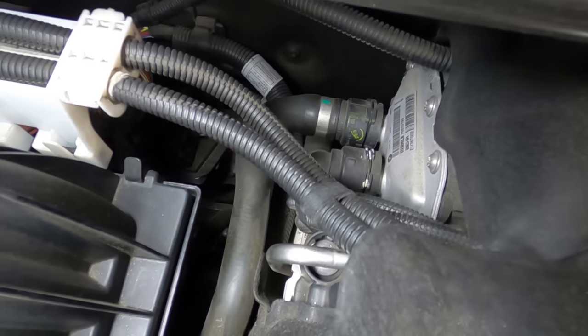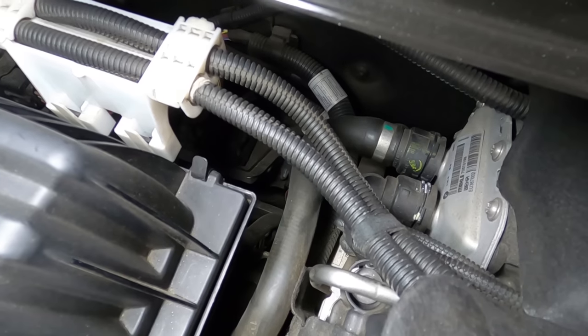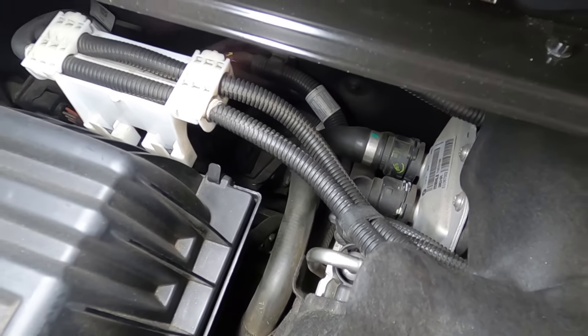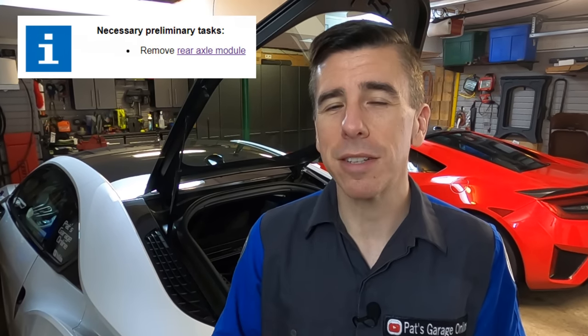It's nearly impossible for me to get my hand in there. I can't even reach it from the bottom of the car — I've had the panel off the bottom and actually tried to get footage of what the other side of this engine looked like. So I decided to do some research to determine exactly how to get to this coolant temperature sensor. According to the BMW i8 service manual, you have to drop the entire subframe — you've got to pull the entire engine down. This was totally confusing to me, so I spent some time looking for used engines to get an idea exactly where this is located and what's in the way.